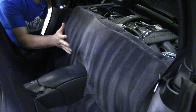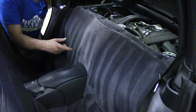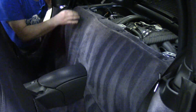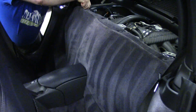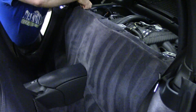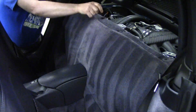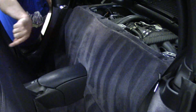If you need to get to the front of the engine to access the auxiliary belt and all the different drive components, you have to take this carpeted cover off — this is also a sound insulator. There's these little plastic screw buttons, there's four of them, and they just unscrew. You can usually do it by hand. I've already done the two on that side. I should mention, I've got both front seats folded forward and slid as far forward as possible to get as much room out.